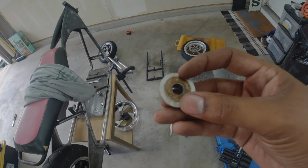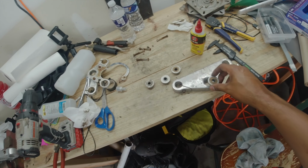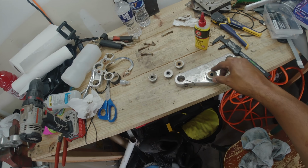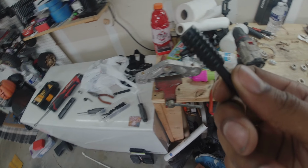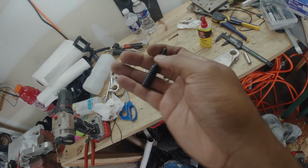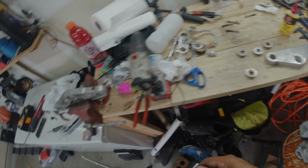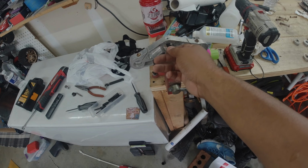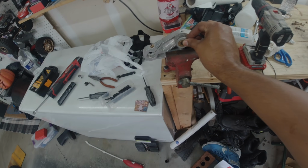Man, I took these little spacer adapter things out of the silver wheel forks, and I'm gonna put them in the triple tree of the black wheel forks, but the hole is like half of a millimeter too small. So I'm gonna take my little grinding tool that I bought off Amazon, and I'll put a link in the description, and I'm just gonna put this in my drill and grind that hole out just big enough to where I can fit these in there.